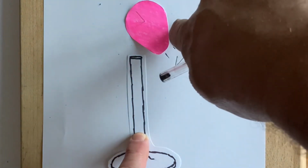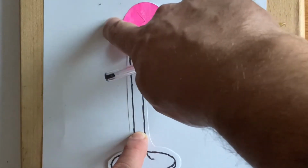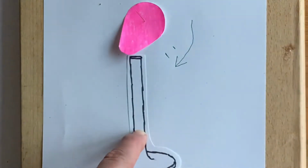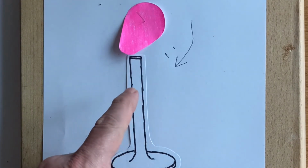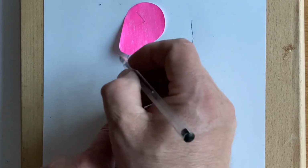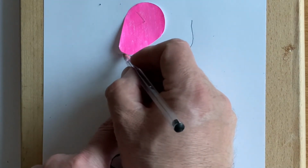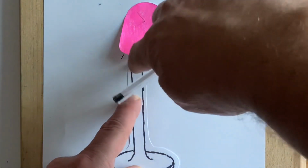So I'm just going to move the camshaft around. I won't move the valve down this time, but hopefully you realise that it would have opened the valve, and now the valve spring is closing the valve and pushing it up against the camshaft. So it would start closing at this point here with the larger gap.